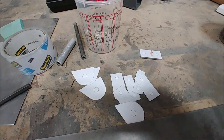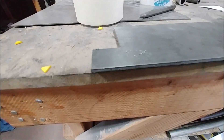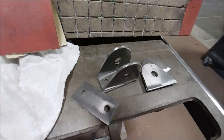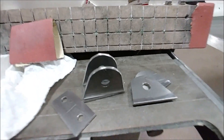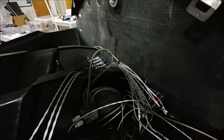I also had to do these other brackets for the other end of those rods for the engine mount. There are all the little templates — I'm going to be cutting them out of eighth-inch 4130. This is what they look like when they're all done and drilled: two of those ready to have Brit weld them up, and then they can bolt to the firewall.